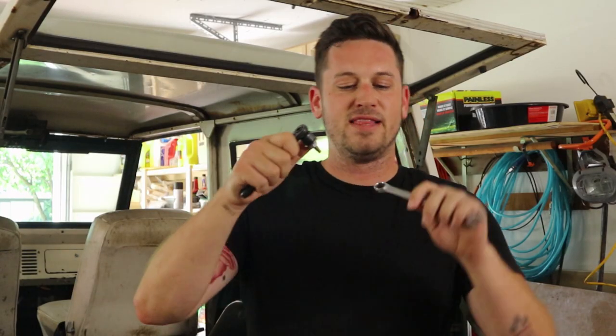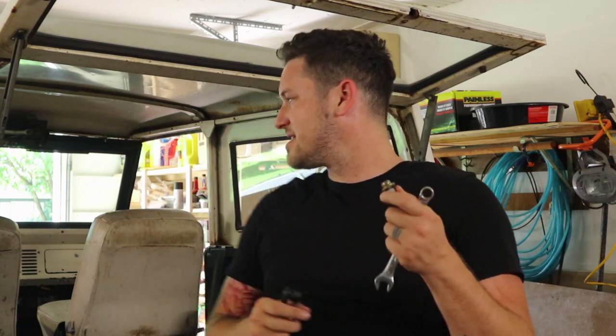I just take a small half-inch socket, get it on the top, and then under the bed rail I'll put my half-inch wrench under there and loosen it up. There are seven of these on each side — so potentially 14 total — and it's going to take a little bit to get to them. Some of them are super tricky to get to. I only keep four bolts on the bed rail, putting them in the easy spots, because all I'm really doing is holding my Bronco down — not trying to seal it up for the winter. If this is the first time you've taken the top off, these bolts are probably pretty rusted, so make sure to hit them with some PB Blaster. So that's the back — let's go up to the windshield.